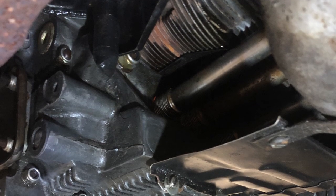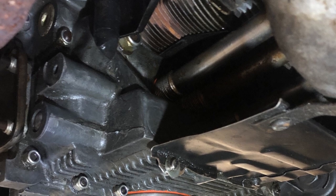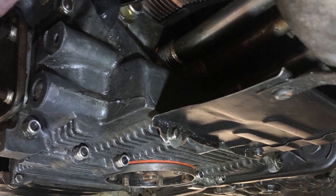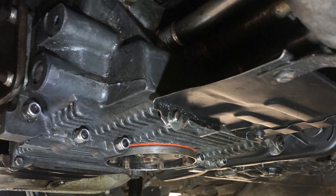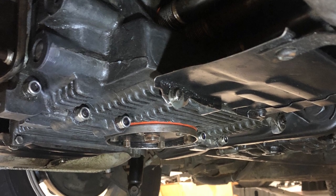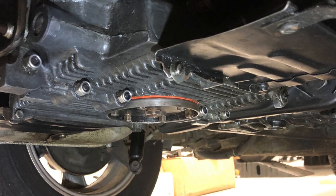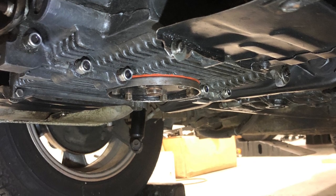Changed the oil. Looking up underneath here — and you may be thinking, wow, he sure cleaned this thing up for this video. But no, it always looks this way. I use the neoprene gasket kit from Wolfsburg West, and it sure beats the original paper cardboard-type gaskets that Volkswagen used to use. Really, no drips. A little bit of seepage, not bad. Nice and clean.